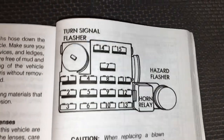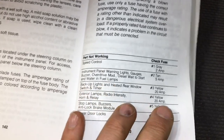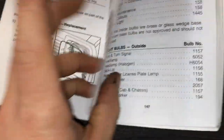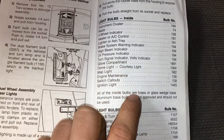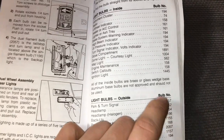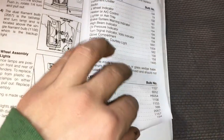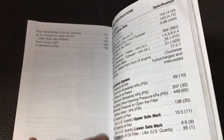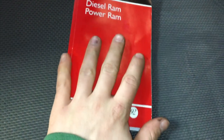A quick tip: if you still have your owner's manual, it shows you where all your fuses are, what your different relays are, and what amp fuses work for which part. I also found that the owner's manual lists all the bulb numbers for the interior and exterior lights, which is very handy as a reference when looking for LED replacements so you don't guess the wrong one. The cargo lamp listed is 922 — unless I ordered the wrong one. I actually got this owner's manual from Gino's Garage since I didn't have one — they make reproduction ones.